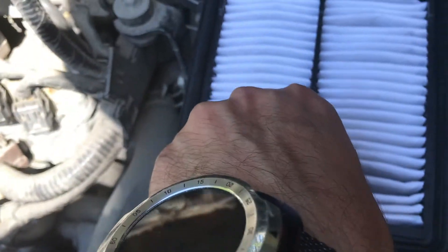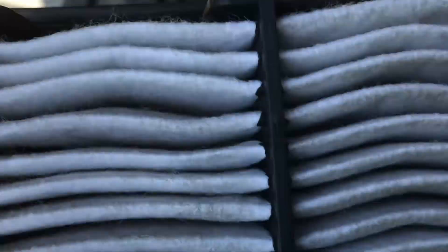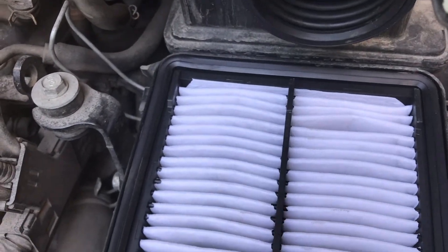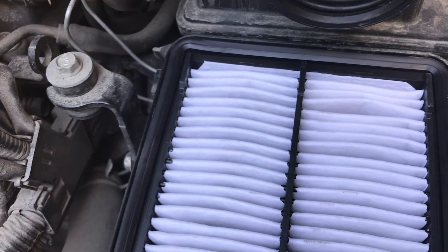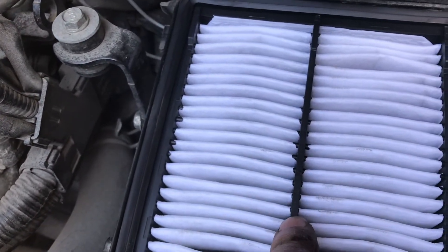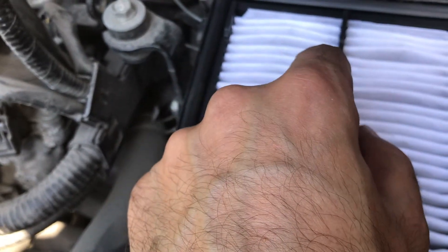...it's going to go through here, then pass through the filter — the particles are going to catch on the other side. So this is the clean side of the air filter, and the other side is the dirty side. You can see we have some debris in here. What it does is catch all of that, pass the clean air — and it's very crucial to get clean air with these newly made fuel injection engines, because if this is missing there is a good chance your engine catches fire. So make sure you always drive with the air filter in place; it's not a carburetor engine that can run safely without it.